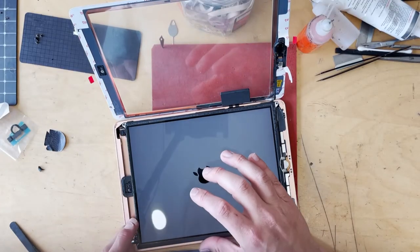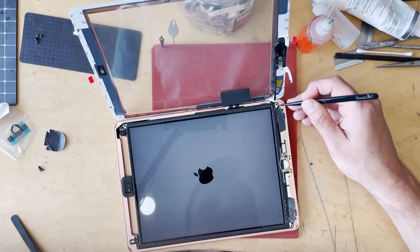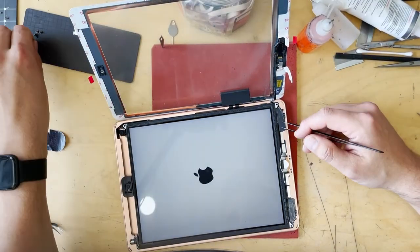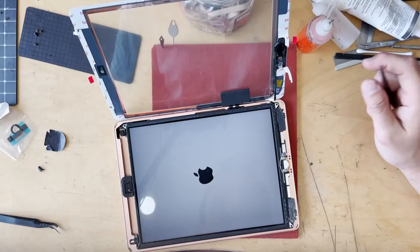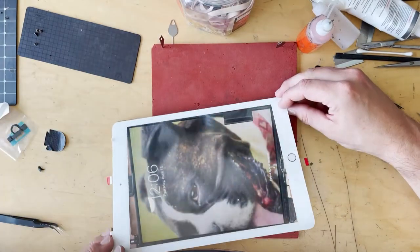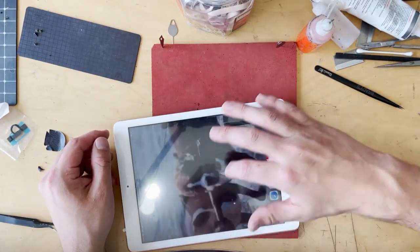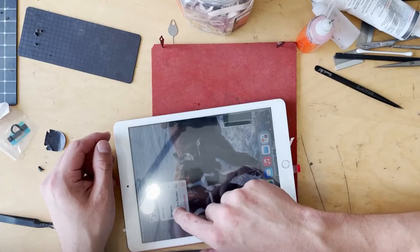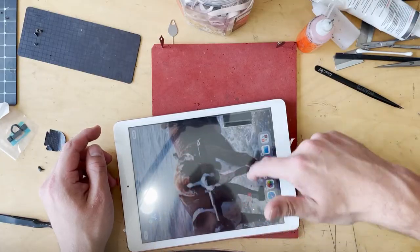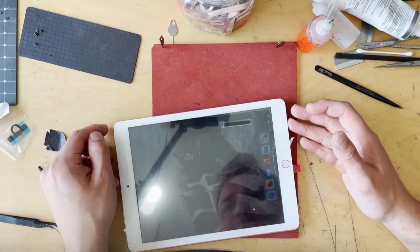It's booting up. I don't need to re-glue these corners — they're screwed in. I think it's overkill that they were ever glued in the first place; previous generations before the 6 weren't glued and there's no problem with that. We put the screws back in. The last thing we want to do is seal this up nice and tight and then have an issue with the screen. Home button is working. I take an app, go to Edit Home Screen, and just drag it around to make sure the digitizer is good. Looks good.